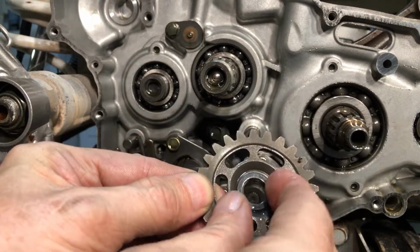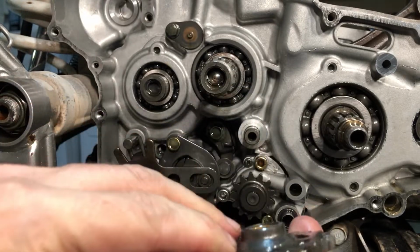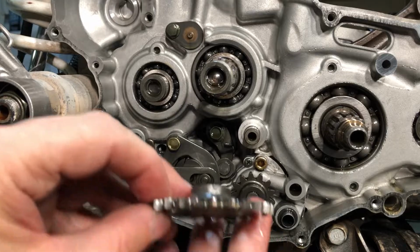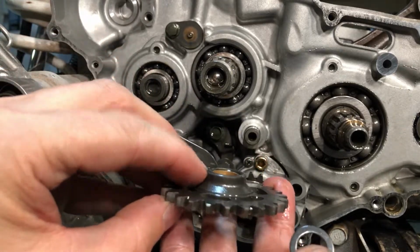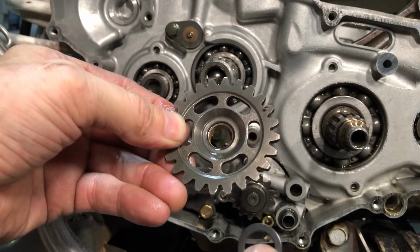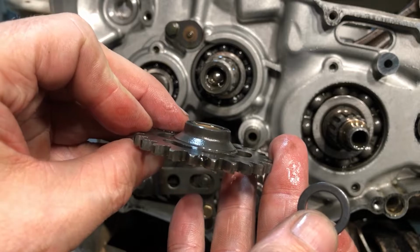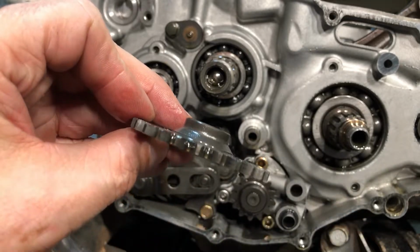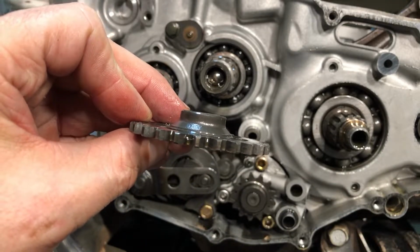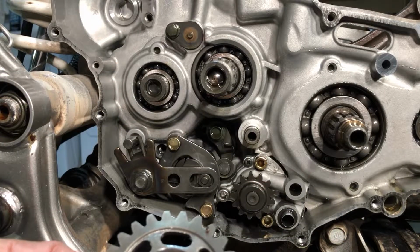Yes. So this washer and the gear, seems like all these gears have a common theme. All of the indents go in, face backwards. So always remember that when we're putting it together, that all these gears pretty much, well, so far, all of them go back there, and the washer's in the front.